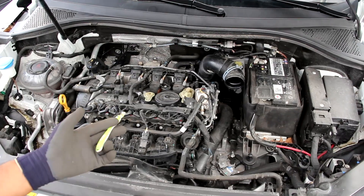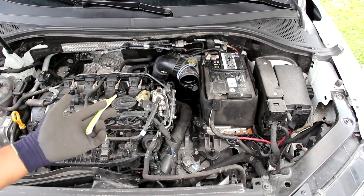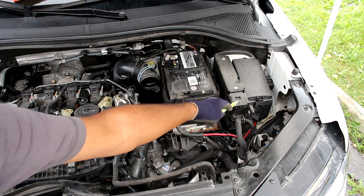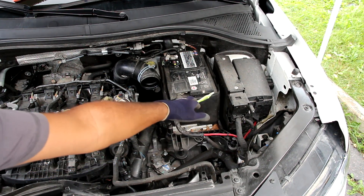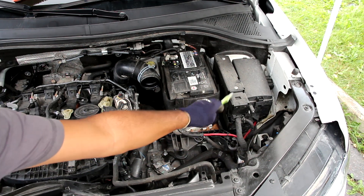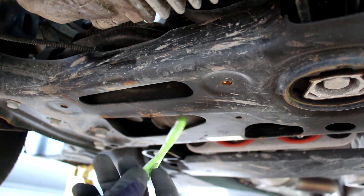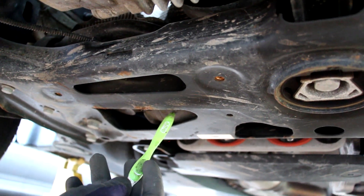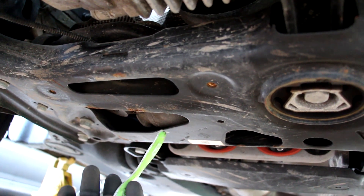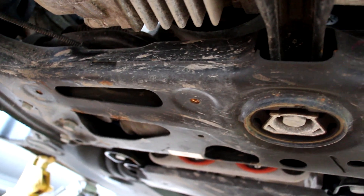Taking an overall look across the engine bay of the Tiguan, it does have its fair share of electronics and sensors. The battery is located over here and the ECU is over here — I don't typically like that because it's subjected to weather or impact damage in a collision, although it is in a steel casing. The fuse box is easily accessed from the side but it's not even labeled. The steering system is electric power assist, with the electric motor located down on the rack, open to the elements, although that should aid with cooling when you're on the autocross.